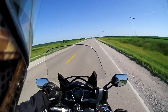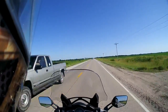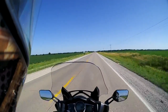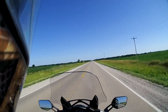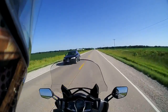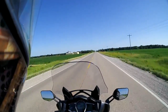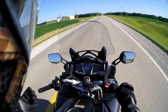Right down here I've got 2 adjustment screws to adjust my headlights up and down. If I'm carrying a lot of gear or a passenger, you know, that puts weight on the rear of the bike, that tilts the headlights up and can make them shine in cars' eyes. And the headlights are good enough on this bike that they will get oncoming traffic angry with you. You can tilt your headlights down and adjust them depending on your load. I really haven't touched them very much, just because if I'm riding at night, I usually don't have my wife on board.